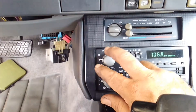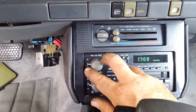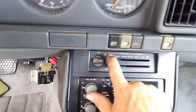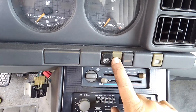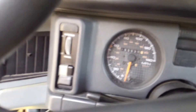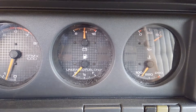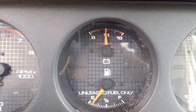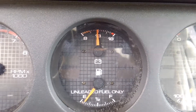Let's go ahead and put the radio on. Still where we want to be. Now let's put the defroster on high and the rear defroster on, so we create a maximum amount of load on the system. We're dipping just a tiny bit but it's pretty much negligible. Going ahead and turning the headlights on — I've got headlights going, maximum load of everything that can be on in this car. You see it drop just probably half a volt.